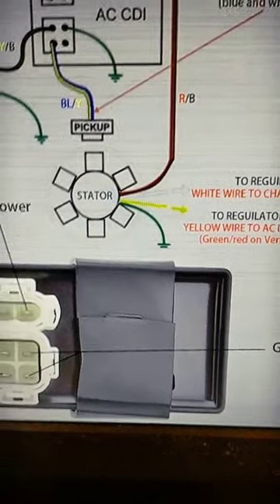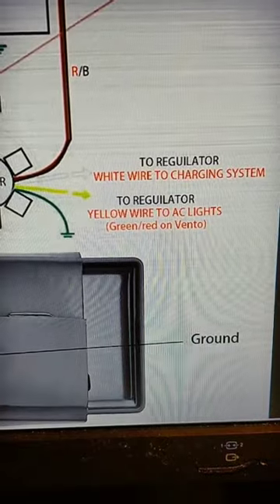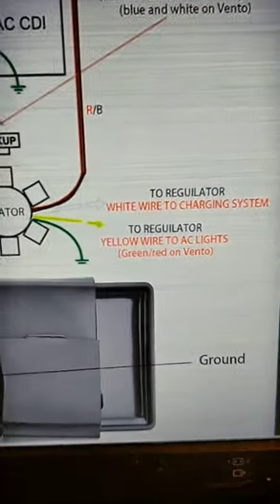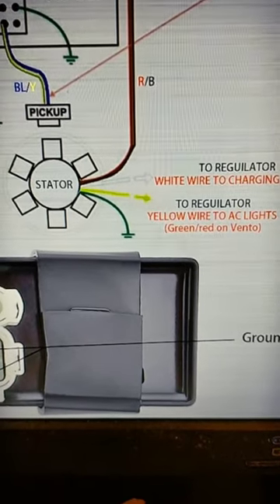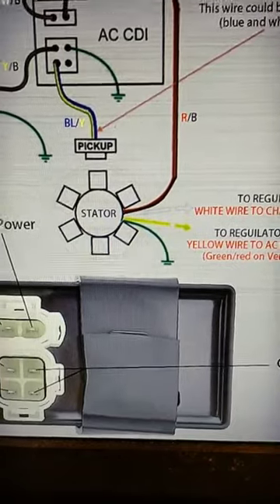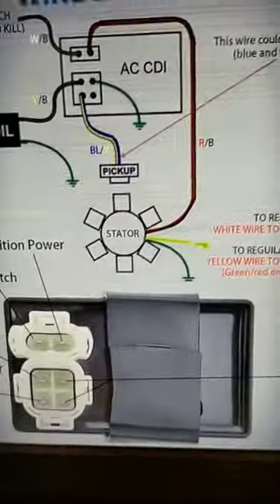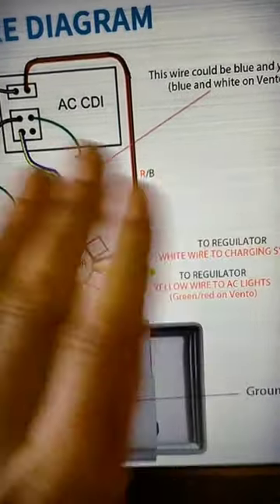Tomorrow I will be getting a multimeter so that I can connect up my regulator correctly and wire up the charging system — not the lights yet. We're going to wire up the charging system through the regulator temporarily, so I can use the drill to spin it and charge up the battery and make sure everything's going properly. We're also going to earth the stator. Some diagrams from the same system do say you can just delete the earth if you wish, which makes me think it probably has nothing to do with balancing the load.